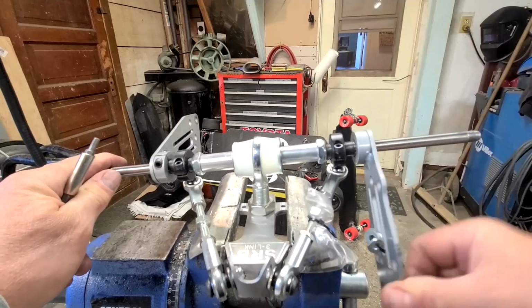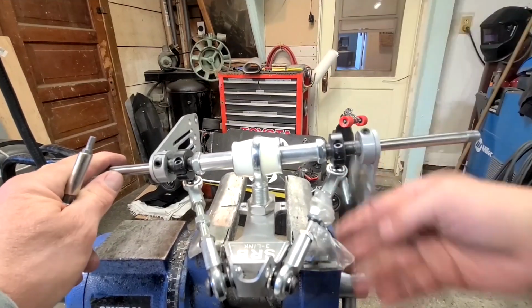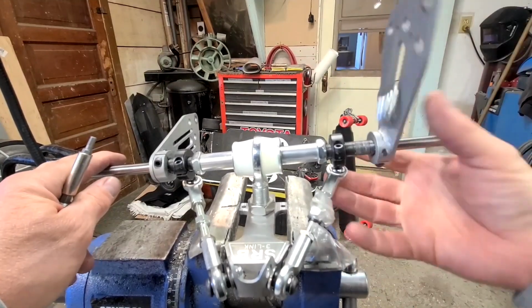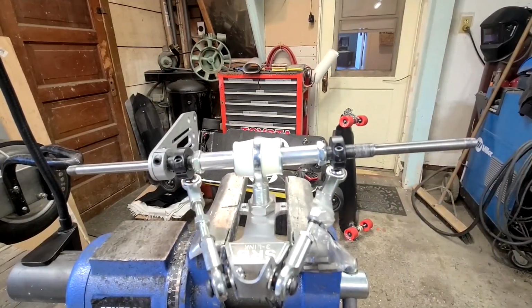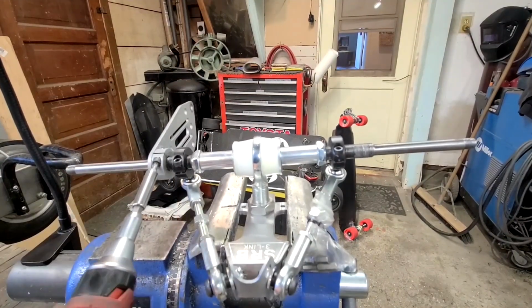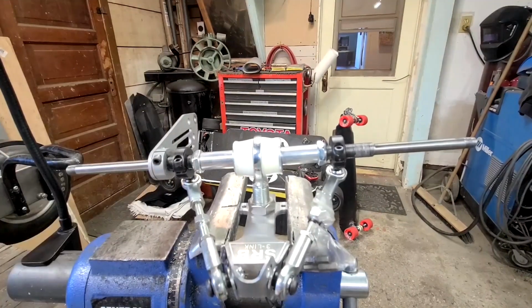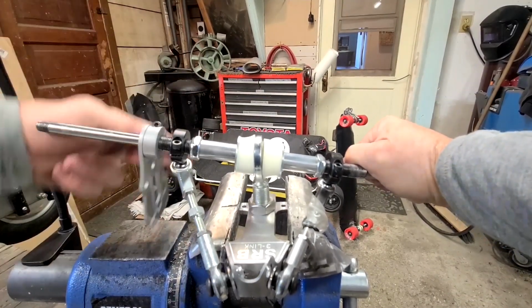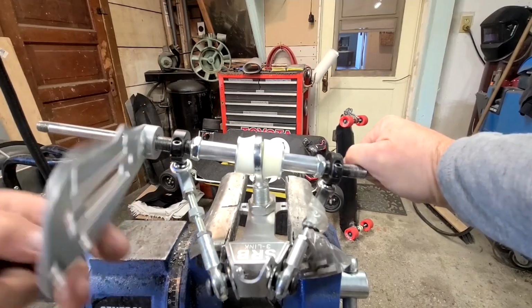The HD is our heavy dude axle. It's made from 5/8 alloy steel versus the 1/2-inch alloy of the standard axle. The larger axle increases the contact area for the HD motor mounts and the radius rod mounts, and what this means is a stronger rotational mounting grip.